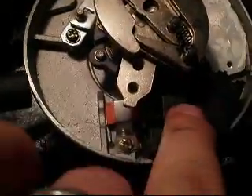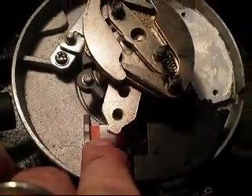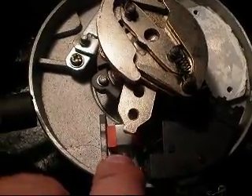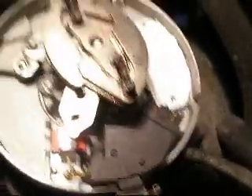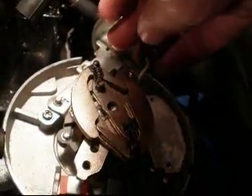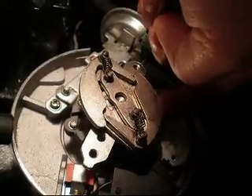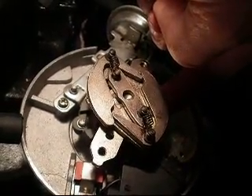You can see down here, this is a condenser or radio suppressor that keeps all the noise from the ignition from being picked up by the radio while you're in the car. And these two wires back here are your pickup coil — they're kind of bent. I've got to inspect these really close because if your pickup coil is not working, you're not going to have any spark.